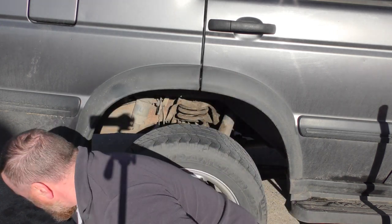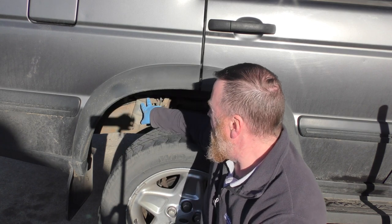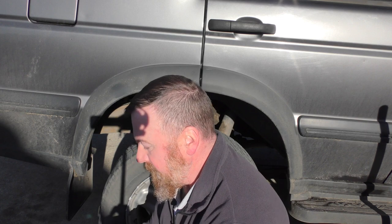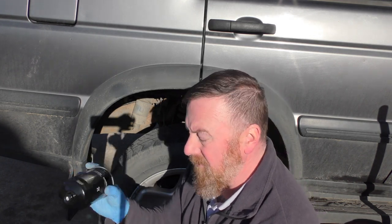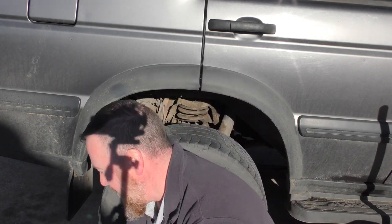Get a bowl. There's no other word for it — it's messy. When you undo that, all the fluid's going to come out — diesel — it's going to make a mess everywhere. The bottom bit you want to put on the new one, because they don't come with it — that's the sensor. But the reward for doing this is massive, I'm honest with you. It really is beneficial, it'll do a lot. Just to give you a lot more diesel coming through, because they do block up. Diesel is just a dirty, dirty fluid.